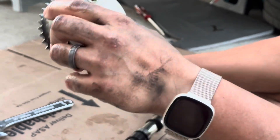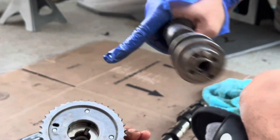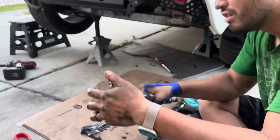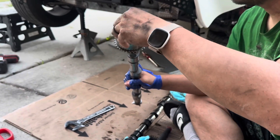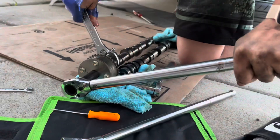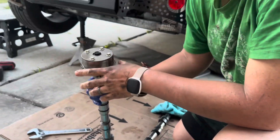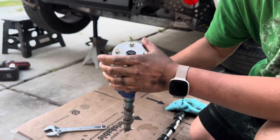Once you've got the four five-sided bolts torqued down, make sure it's not locked — you can tell it's locked because this dot right here will be lined up with that dot. Right now it's unlocked, which means we can put it on the new camshaft. Torque it down to 40 foot pounds, then we can go in and lock it. To get this back into the new camshaft there's a little notch — line that notch up with the circular indentation. Now torquing down the bolt — 40 foot pounds — check the lock — still not locked, good.